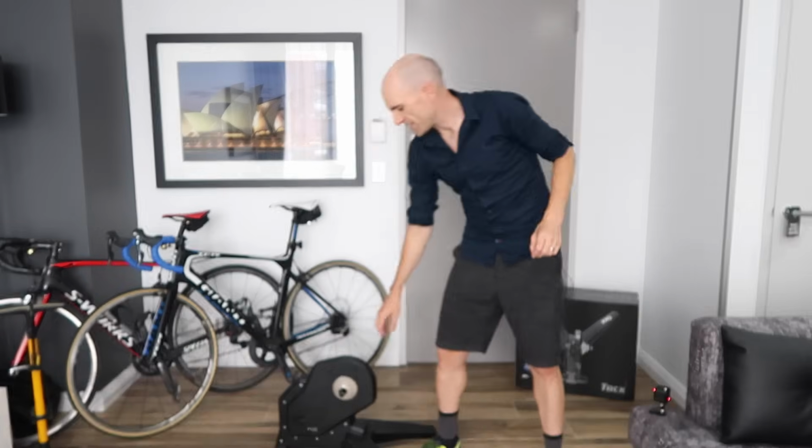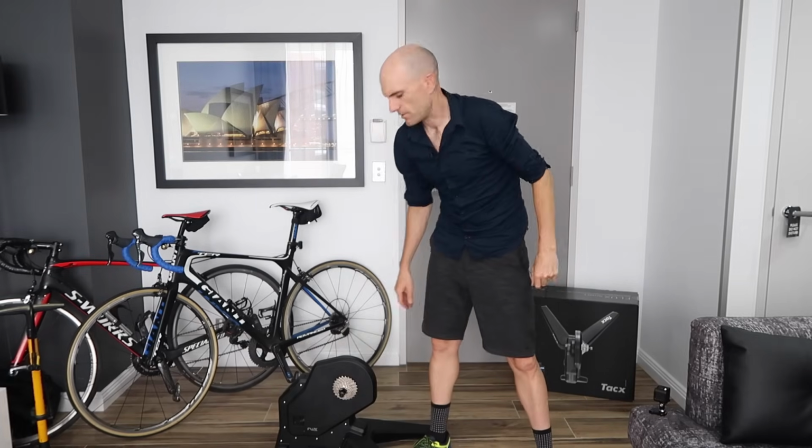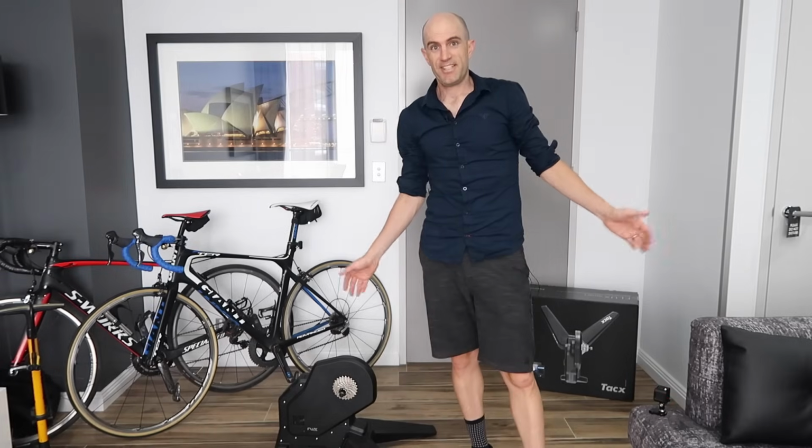The only real tricky part is getting the cassette on with the Edco hub. The multiple compatibility means it's got different teeth in different spots. It's not as easy as putting the large cutout onto the large cutout on the Shimano's if you're fine with that. But if you're buying this from a shop, get them to install it for you. No hassles at all. So I guess there's one thing left to do. Let's go for a ride.